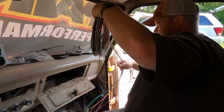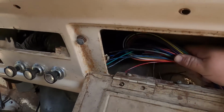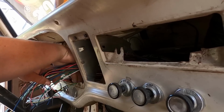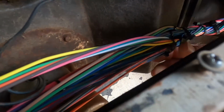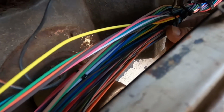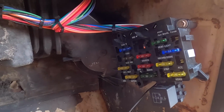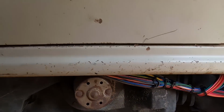Next thing we're going to do is take the remaining wires and run them from the fuse box, which is on the passenger side, over to the driver's side of the truck. Some are going to stay there for the instrument cluster and switches and controls. The others are going to pass through the firewall and then split, whether they go to the tail section, additional things of the engine, and stuff like that. That looks like how the original wires went, so we're just following suit. So we'll feed these bundles across the inside of the dash and over to the driver's side.